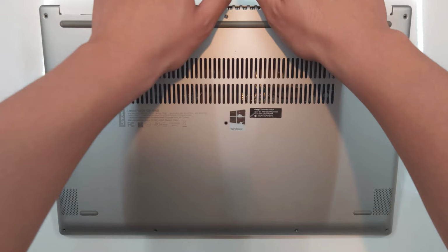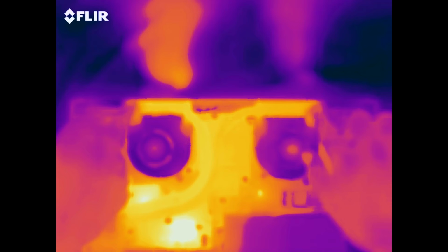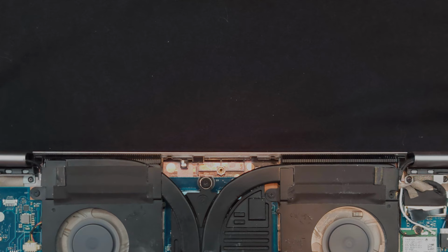In most laptops, like this Lenovo right here, heat pipes transfer heat from the processor to a finstack style heatsink. A centrifugal fan pushes air through the finstack. Notice how the gush of smoke from my wind indicator very quickly goes through the heatsink and exits the laptop. The air coming in is cool and the finstack is hot. So as the air flows across each fin, heat is transferred to the air, which exits the system. Therefore, you have a net transfer of heat out of the laptop.